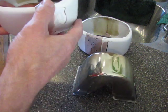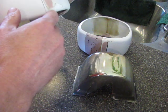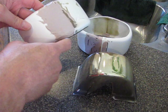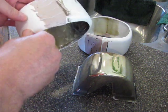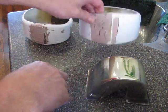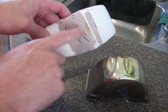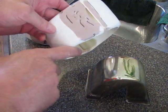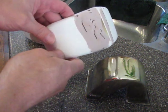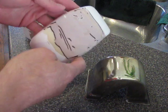Here are the two pieces together. As you can see, this side is finished while this side is not — it's a rough fill with Bondo and has not been taken down yet. Here's one that has the first stages taken down, and you can see all the black marks where I've gone through and marked with Sharpies where I need to go back and fill in and do it all over again. And the same on this side.